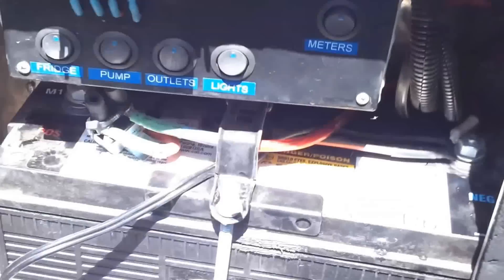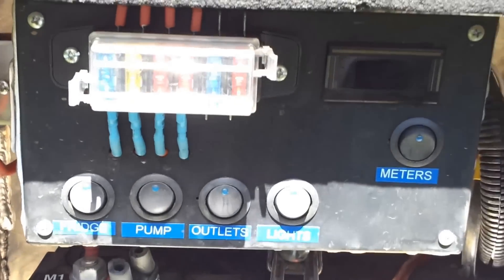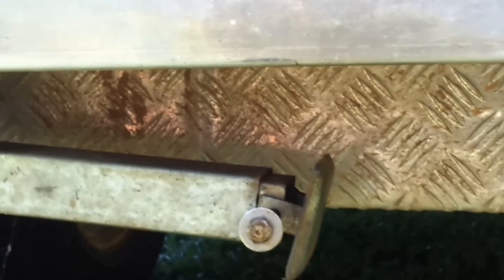As part of that I had to put a battery system in. My son did all the fittings and fuses with a kill switch, so I can turn it on and off and it lights up to show everything is working and ready to go. I've also put in a 60-litre tank underneath. Because of the weight of the kitchen I had to counteract that, so the water tank goes underneath with a checker plate cover so it's still high enough for driving and supplies water to the kitchen area via a pump.